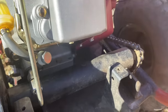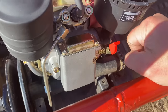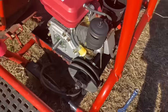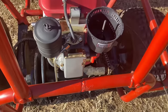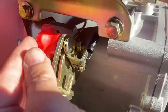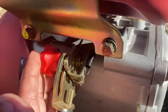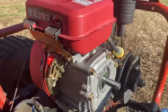Also, I figured out I can shut the engine down by pulling down the compression release, and that's also how you crank it. You have to push the compression release down and then pull it, but that thing is tough to pull. Or this can be turned off by putting the throttle control all the way up here. So I'm just going to have to figure out how I want to shut this thing down,